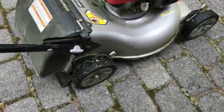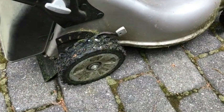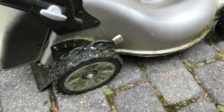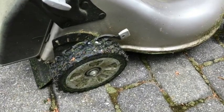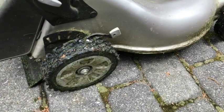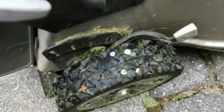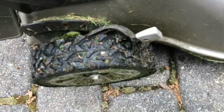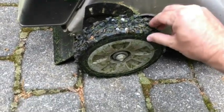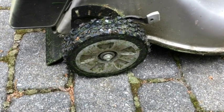It's been a few days since the retreading, so I decided to take the mower out and see how it works today. It's a little bit wet, which is good because if you're going to lose traction, today's going to be the day. And it worked fantastically — no slipping and sliding. It feels like there's brand new traction in there. One thing that didn't work all that well was the contact cement. It did come up a little bit on the tire side, which is probably because when they make these tires they spray some kind of release agent on the inside of the machine. So what I did was put a few extra screws in — every four or five inches I put in another screw and that completely keeps it right in place. If it lifts up on the edges a little bit that's okay. I'm not going to worry about it, or you can try some other type of adhesive. But this works good for me — I hope you all give it a try.